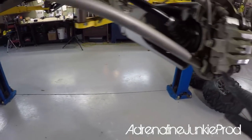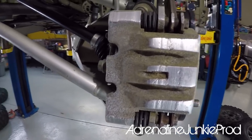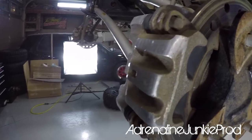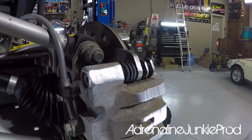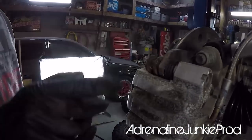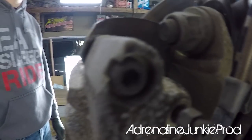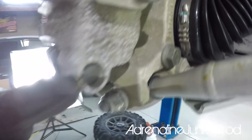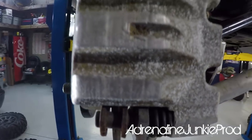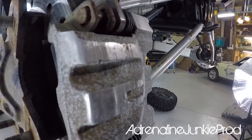The debris from inside the wheels has rubbed right through the caliper casting. I'm pretty sure the local Polaris dealership has a set of those in stock for me as a replacement. That definitely shouldn't be happening — none of the other guys have that. We've all been through the same conditions. My old one had a touch of it, but nothing to this level. This is like shaved off — it's like you took a grinding wheel to it. That bolt's almost exposed. It's broken through.